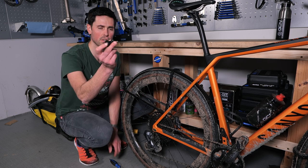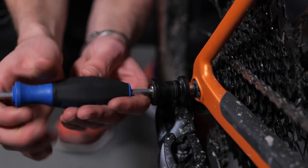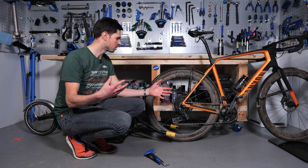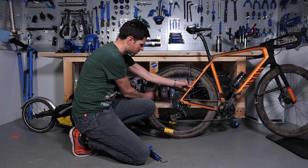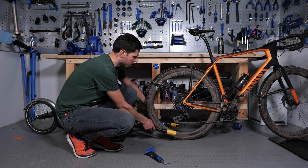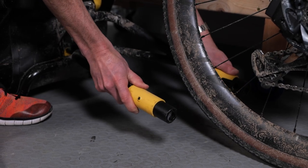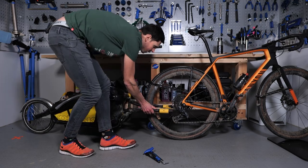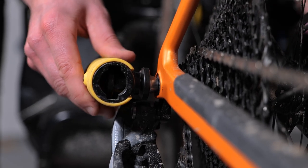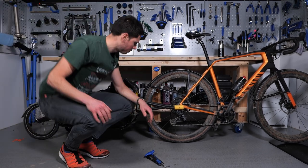That's in place. Going to take the other side of the axle adapter and carefully thread that into place as well — again, torqued to around 15Nm. With the axle in, quick thing to do is make sure that the rear wheel is actually held securely in place with no wobbling — which looks good to go. Then with the trailer close to the bike, either side of the wheel, I just need to pull back these little retaining clips and turn them ever so slightly to hold them out of the way. All it's a case of is simply carefully lifting this up and hooking it over the correct bits on the axle adapter, then allow the retaining clips to snap into place. And look at that — we've got a bike and a trailer.